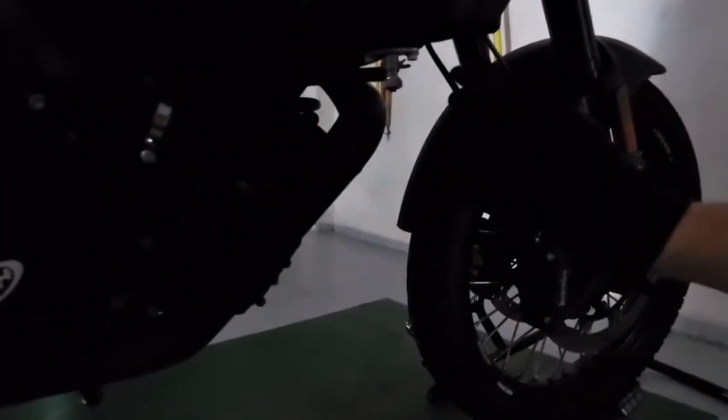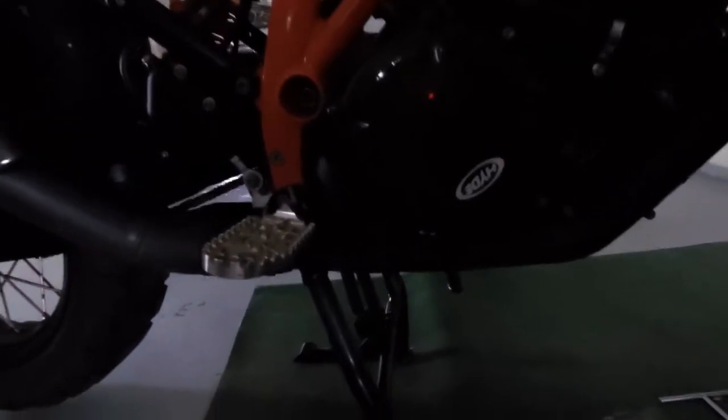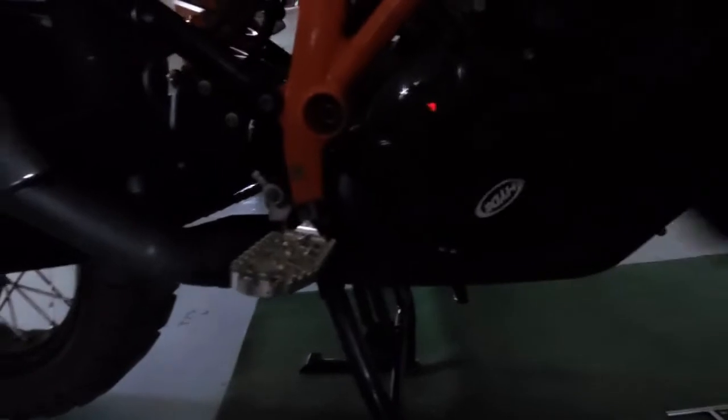I've taken off pretty much everything already. They do recommend that you disconnect the rear brake because you also have to take off the foot pegs, which is a pain because you have to take out the spring. One thing I haven't seen with this kit — if you have the 1190R, this is where the original OEM bash plate sits, but there's nothing to close it off. There's no end cap. So I'm going to purchase a couple of M10 bolts, probably by 10 or by 20. I tried the 30s — there's about a centimeter gap. I just want those things closed off so you don't get any rust or dirt in there.